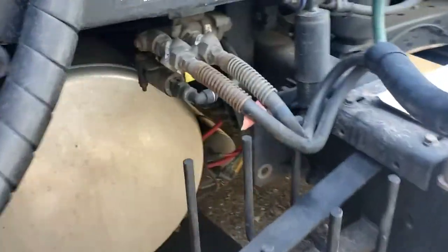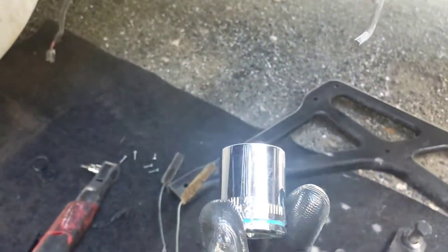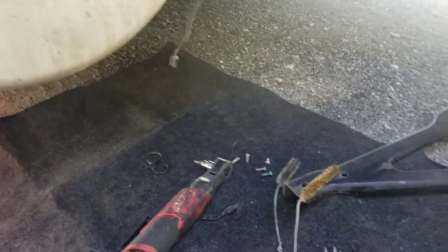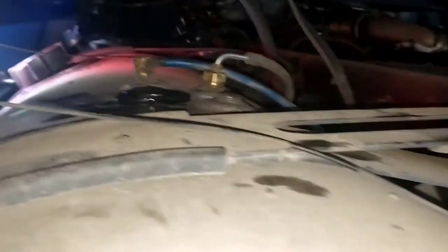First thing I need to show you - on my truck it has side guards here. You definitely don't need to drop the tank. In order to have better access, this one has a support arm over there. This requires a 24 millimeter socket to remove these big bolts right here. You can use the ratchet to loosen it up and then use a power wrench. There is another one that requires a 14 millimeter socket. Remove that and you can open it up a little bit - expand it - it won't break, and then you have full access right here.